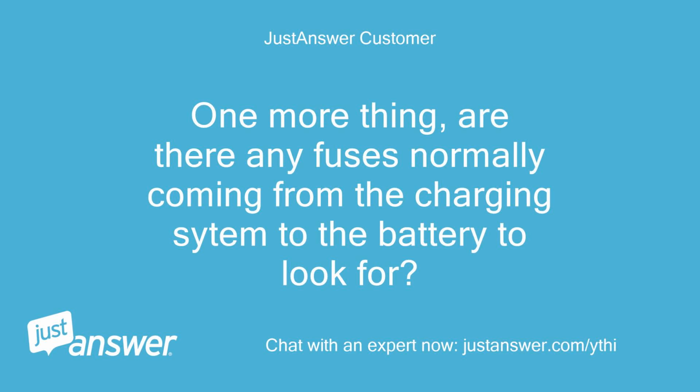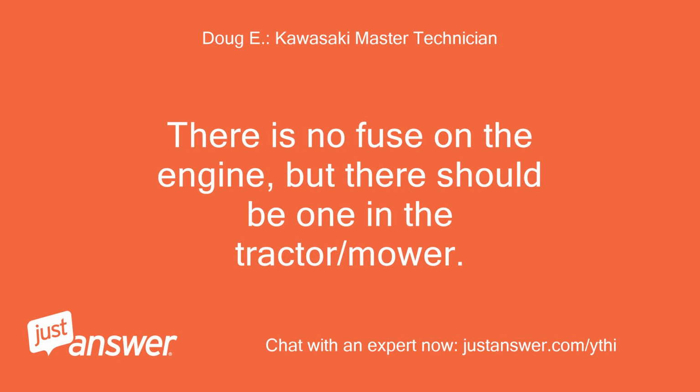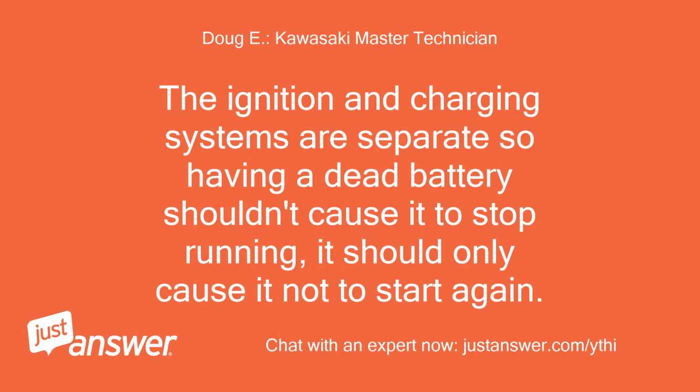One more thing, are there any fuses normally coming from the charging system to the battery to look for? I am only an expert on Kawasaki engines, not on all the products they are used in. There is no fuse on the engine, but there should be one in the tractor slash mower. In most cases, it's near the battery. The ignition and charging systems are separate, so having a dead battery shouldn't cause it to stop running, it should only cause it not to start again.